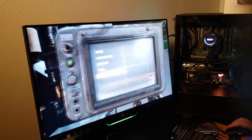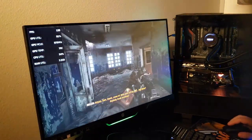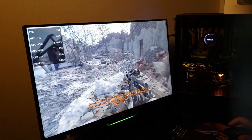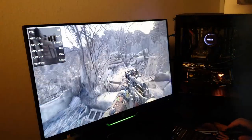Last little stress test — we're in extreme mode for quality. You can see the GPU temps are actually much lower than they were. And look at our FPS: 90, 100, 99, 101. We're getting a steady 100 frames per second. I'm seeing 80, drop to 80, back up to 102. So at the end of the day, I think what we accomplished here is really impressive. The frames were looking great. The liquid cooler is amazing — we're getting probably negative 10 degrees Celsius from our previous setup using the Wraith Spire. And not only that, the GPU is getting better airflow because there's not a big bulky fan sitting on top blocking all that air.